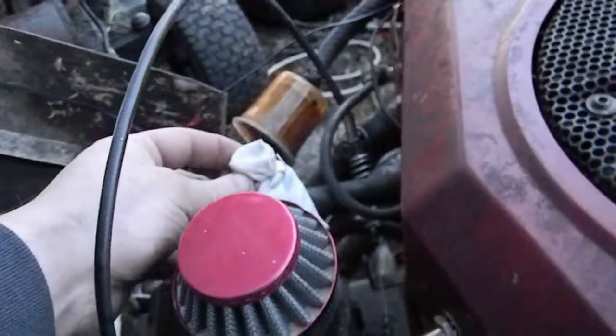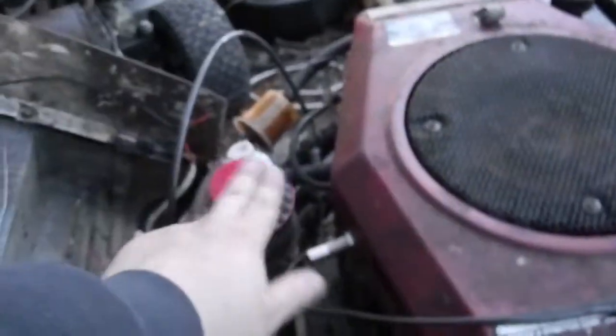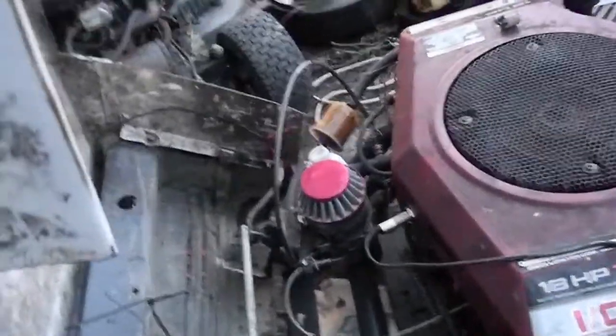The air box doesn't fit, so this is my crankcase breather filter — it's been working because that's dirty up there. This is supposed to be a two-stroke racing carburetor filter and it fits perfectly over the Briggs and Stratton intake, so that works out.